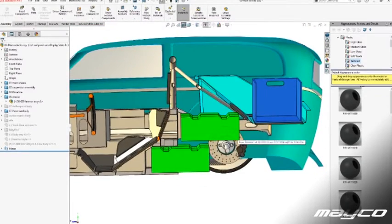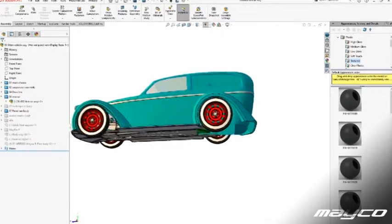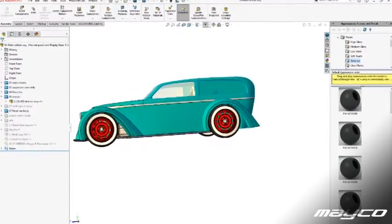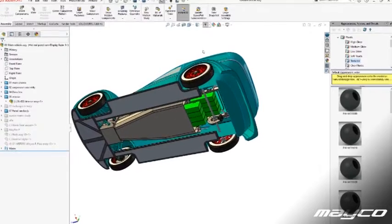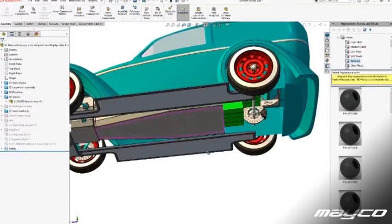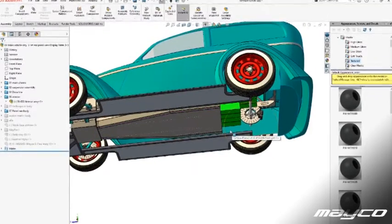As I mentioned, I had to place the roll hoop a little bit forward to get that trunk liner in there, and that also meant that I had to change the battery a little. I have to redo the battery. I work at a company where we also build electric vehicles. We have this type of battery, but in reality it is not really suited for OEM manufacturers, because it provides too little data to really control the battery and to understand the battery, to learn from the battery and to optimize the battery. So I have to look at a different battery.